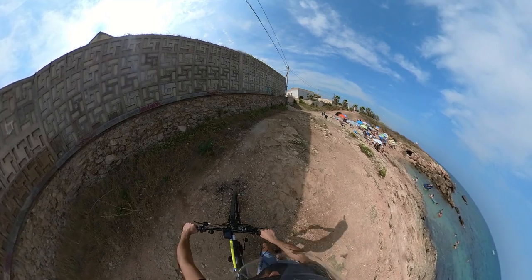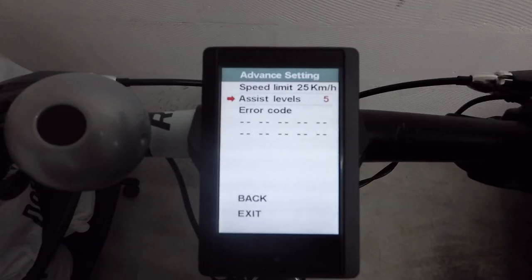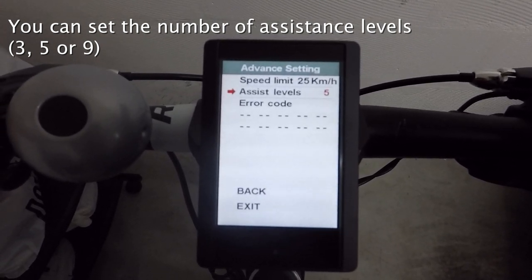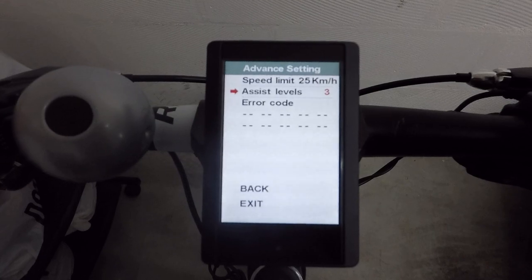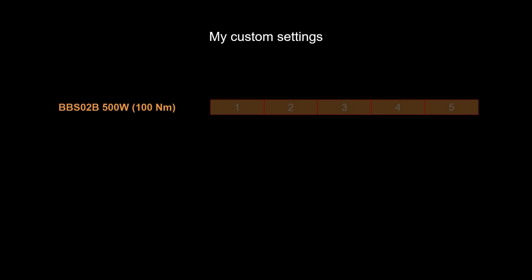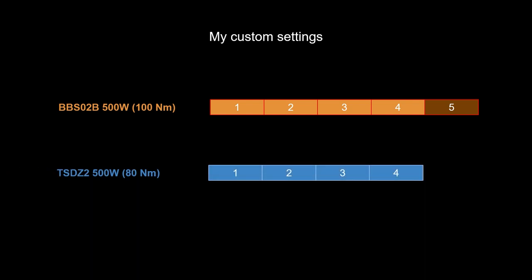As the manual says, I want excellent low cadence assist typical of torque mode and the extension of high cadence power mode. On the Bafang kit, you can specify the number of assistance levels: 9, 5, or 3. Personally, I always found 9 to be too many and 3 to be too few — 5 assistance levels is my choice. Considering that I basically never use level 5, and that level 4 provides around 80% of the motor's power, I would be happy if at level 4 the custom firmware of the TSDZ2 could be closer to level 4 of my 500W BBS-02B in terms of sustained speed.